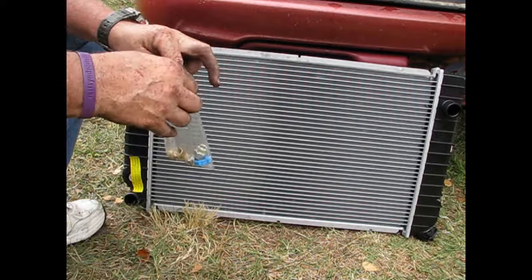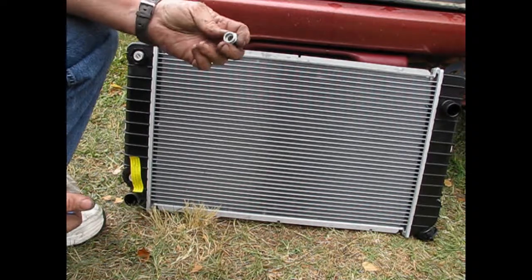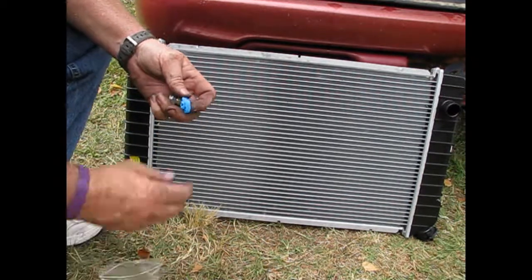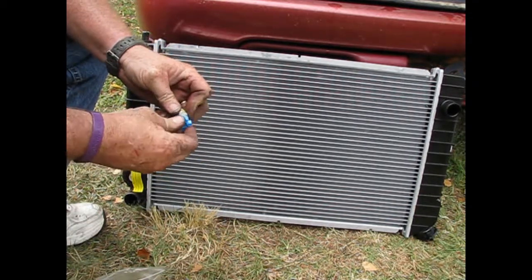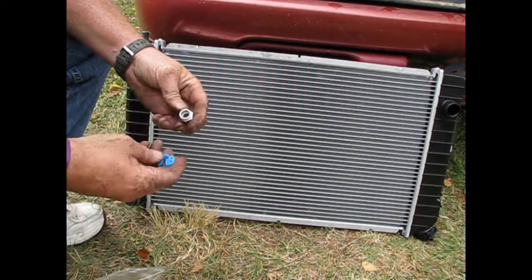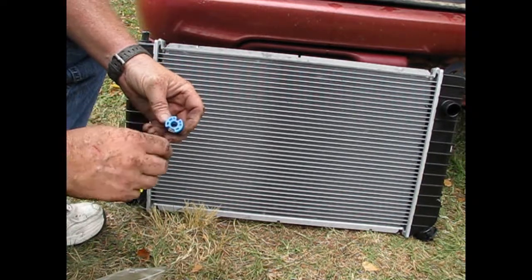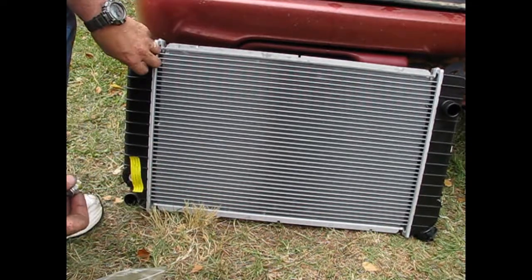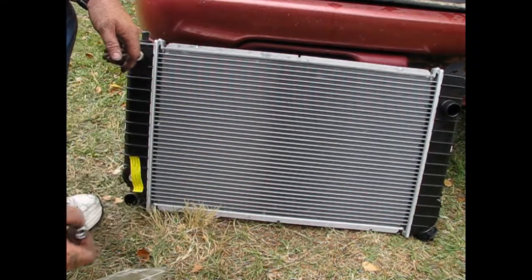This is a little kit that came with the radiator — these are for your transmission lines. What was on the truck are quick fittings, and it even comes with a little tool, which is pretty handy. What you do is put this around your line and push it through — it pulls these little teeth out. Put it around here like this, twist on it, and it separates. Then you just pull the hose out; you don't even have to put a wrench on these. But you do have to put them in the new radiator because you've got brand new ones — fresh Loctite, new O-ring on the inside. You want that, believe me.